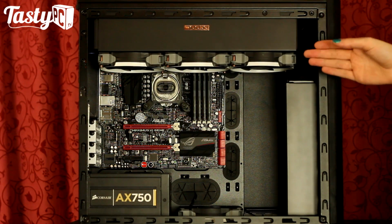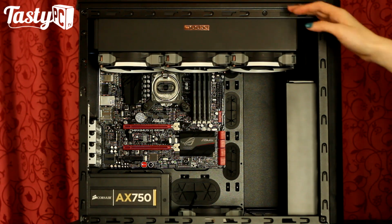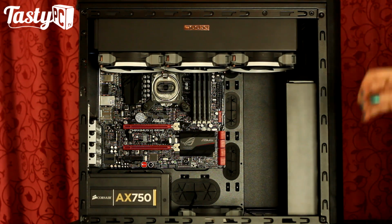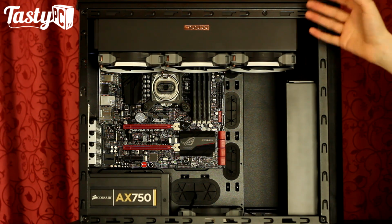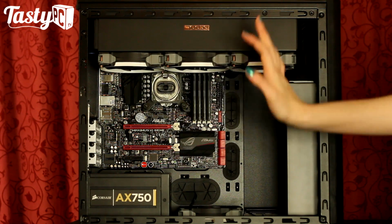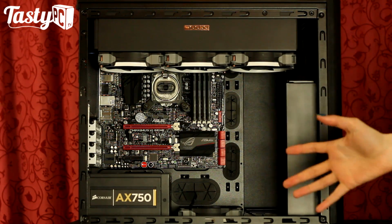And then lastly, I've just fit a 360 and a 240mm radiator in the Arc Mini R2. Now this is a monster 360 rad in push, which is pretty epic to fit in a Micro-ATX case. And being a 120mm fan-based rad, obviously in this area here we've got the same clearance space and clearance issues that we saw with the two 240mm rads.